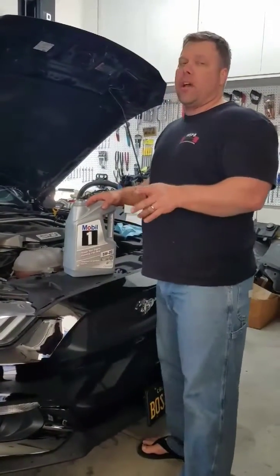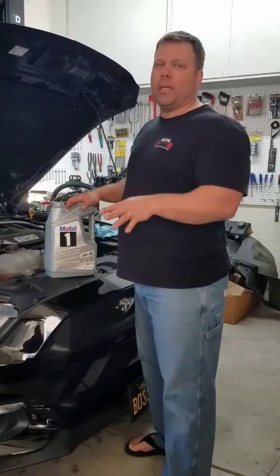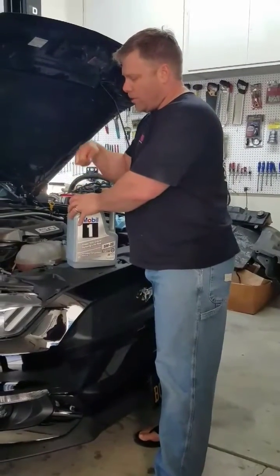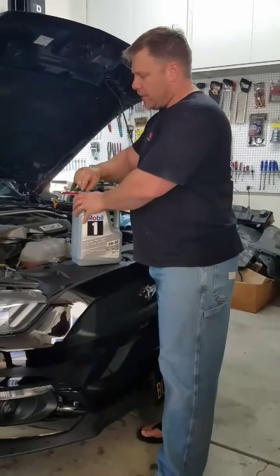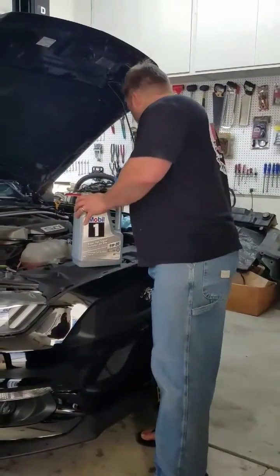And believe it or not, people, you can break in an engine with synthetic oil. That's an old myth. They get dispelled all the time. So I've already added 5 quarts. I'm going to add the remaining 3. We'll start it, check it, and we will go from there.